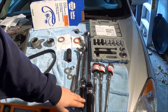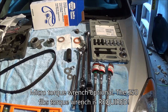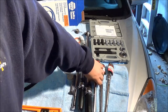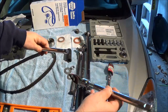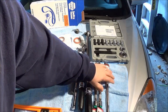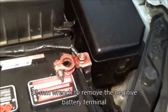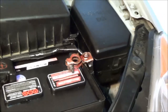This micro torque wrench gives me torque settings for my plastic covers on the timing belt. The big torque wrench will torque down the harmonic balancer bolt to 103 or 105 foot-pounds. These three extension bars will get me out from the wheel well so I can torque down the bolt. Make sure you remove the negative terminal on the battery and put it aside so it's not touching — I've got a cap on there from an existing battery. You don't want to cause any electrical sparks, so you always remove the negative on your battery when you do a timing belt job.